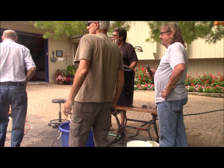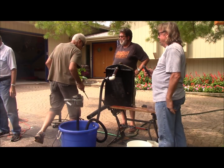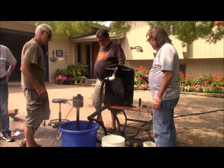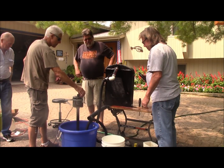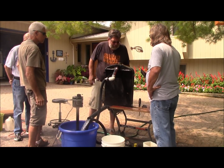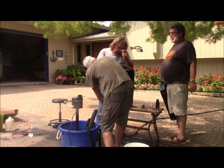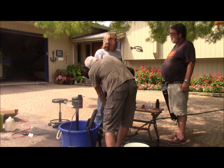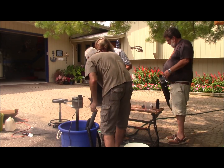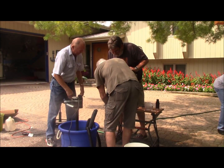With this setup it's pretty easy to pop a new radiator onto the shopmate, hook up the two hoses, and we're ready to run some tests. Turn on the pump — it's a big core. It's not flowing over, which means it's flowing good. That guy's a big core and he flowed at 29.8, and we couldn't get enough flow out of the pump to get the water all the way to the top tank. So it flows over 30 gallons a minute.